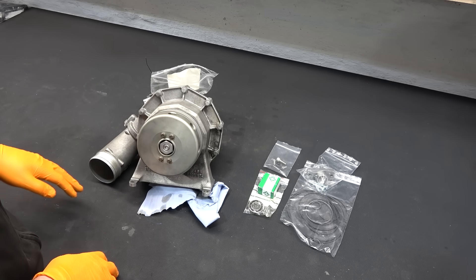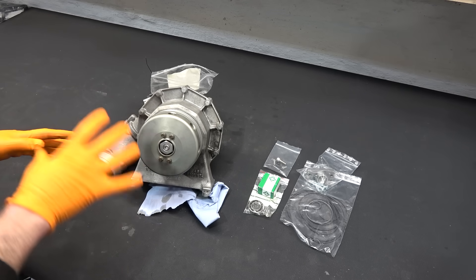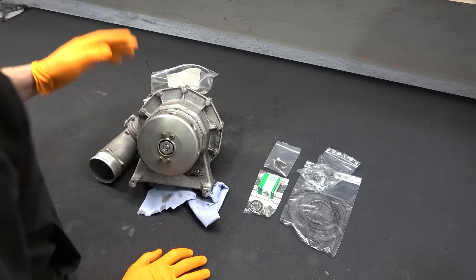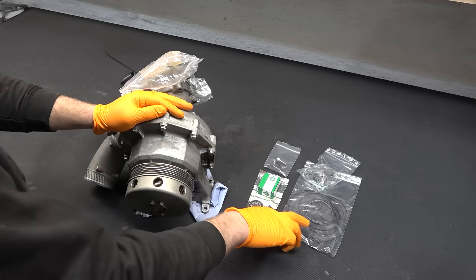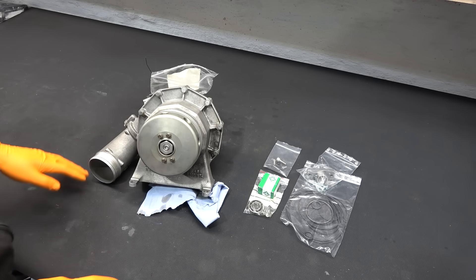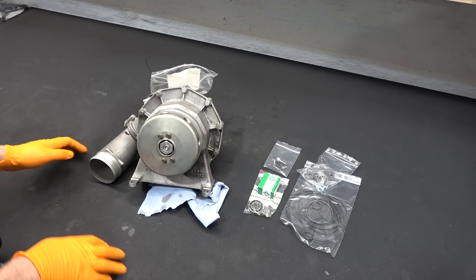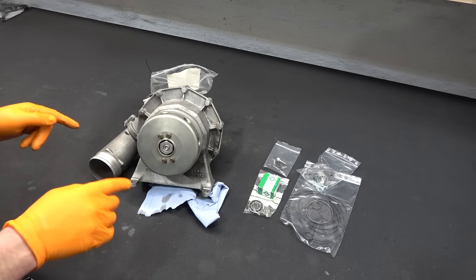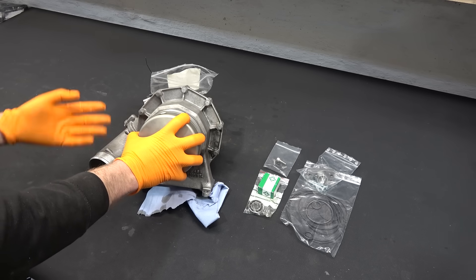This is the supercharger, which worked fine before I removed it. We're not going to do a full rebuild but we are going to replace the clutch bearings, and I also noticed the housing is wet so we'll replace all the o-rings and seals — about 15 million of them. The impeller has no play whatsoever so we won't touch that. I got a kit from Laszlo from Budapest — he has a website dedicated to these superchargers with a rebuild service and parts. I also found a really good video from Vasil from California at b7stuff.com on how to take this apart properly.